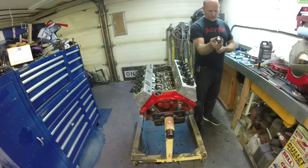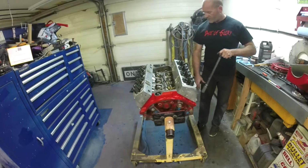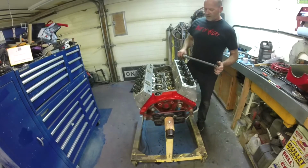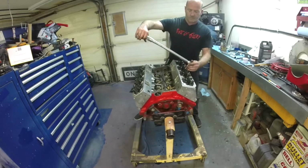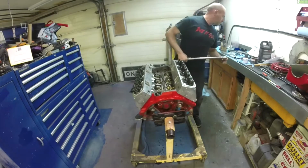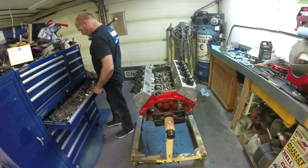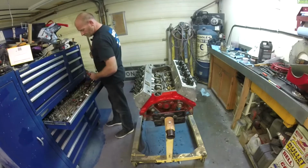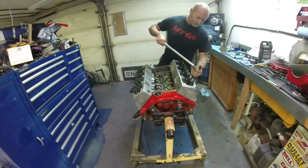Cylinder heads down. So let's get cracking. Standard spiral pattern. No big deal. Away we go. Three stages. 50. And stopping. Game on.